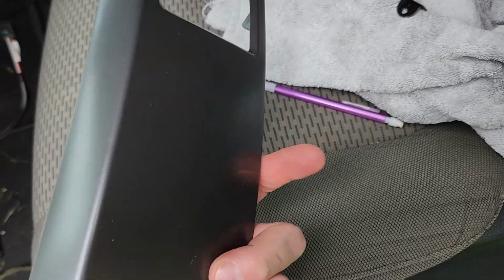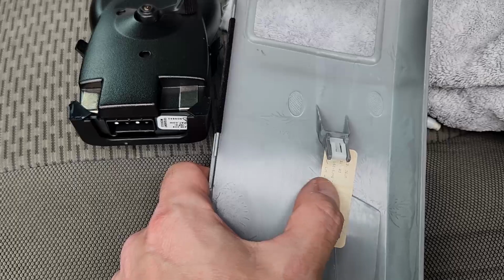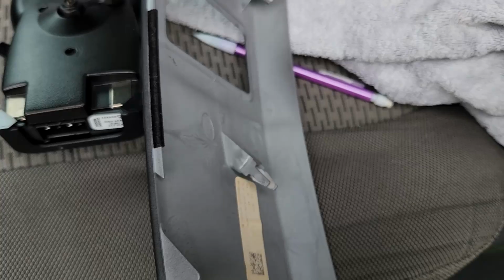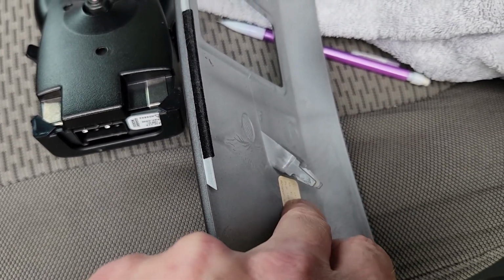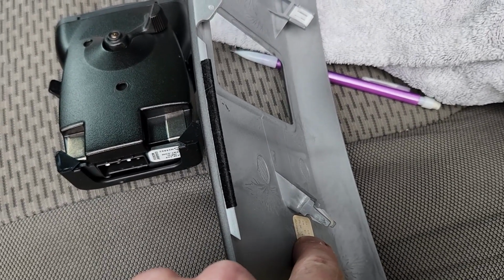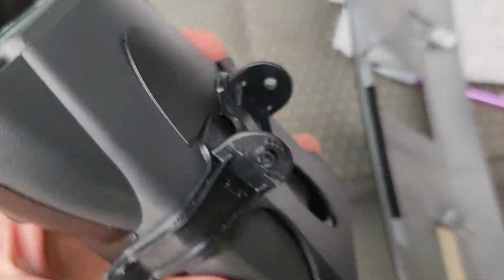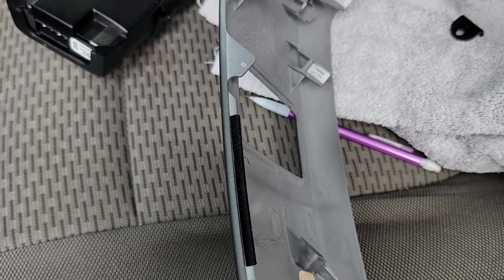And then, let's see, all right. So my thumb is roughly where that bracket's gonna be screwed in. I think there's a little bit of standoff caused by these tabs, but what I'll do is use a truss head stainless steel screw on the inside because it'll be almost flush. And then there's plenty of space between the bottom of this unit and the bracket, so I'll just use the nut on the outside, and you'll never see it because it's going to be buried behind the brake controller.